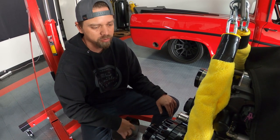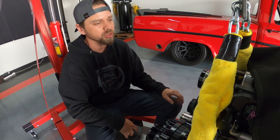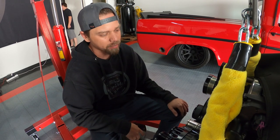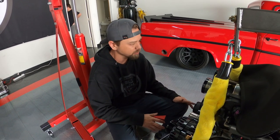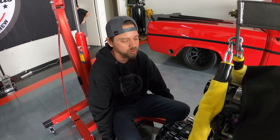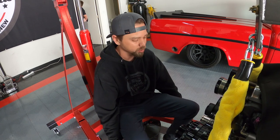We gotta revise the fuel system. Gotta add a little bit extra plumbing for the supercharger because it does have an intercooler. And then it's just wrapping it all up, exhaust, drive shaft, all the little stuff. Once it's back from paint, we'll be doing that. Put on all the exterior trim, which we shaved a lot of off, so that should go pretty quick. And then, yeah, breaking in the clutch and burnouts.